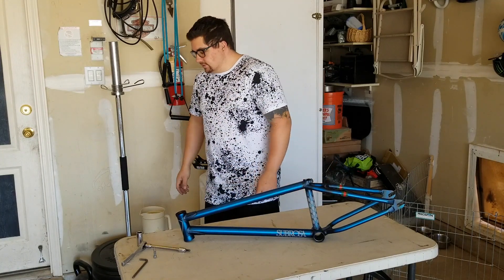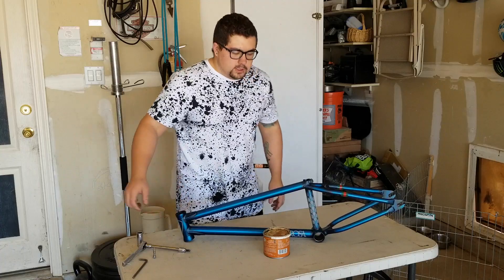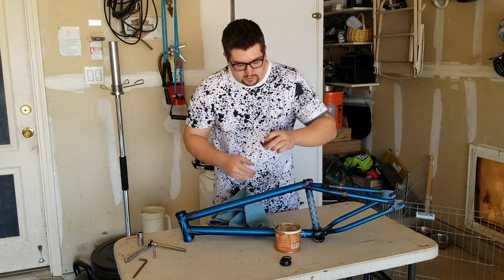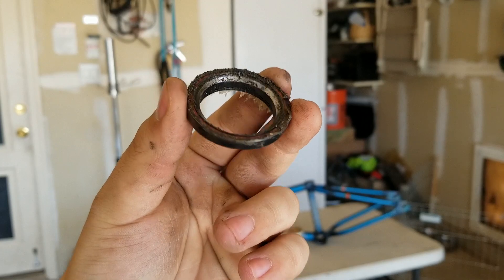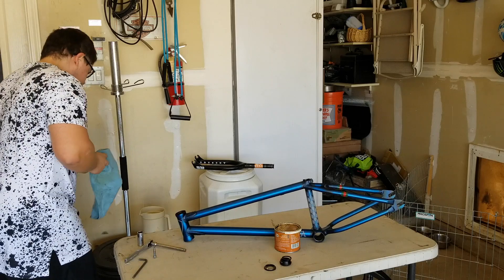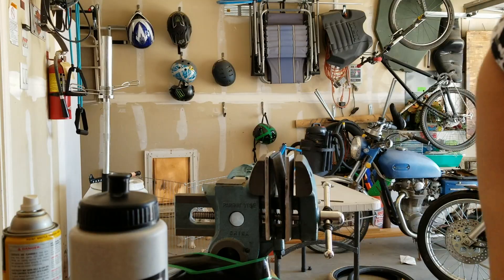The color scheme I'm going for is going to be similar to my last but different in little ways. It's time to put it all together. As always when you build a bike, use grease — if you don't, you're stupid. Whenever you're using old parts, make sure — look at how dirty and gross that is. Wipe all that off before you put it back in. I'm going to put in the bottom bracket first. For years I would always hammer in the bottom bracket bearings, but I finally stopped being an idiot and realized I have a vice that makes everything ten times easier.